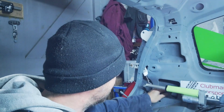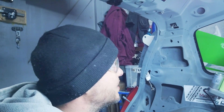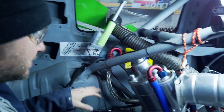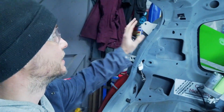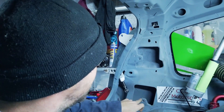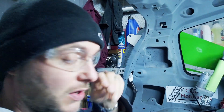They have really thick reinforcements specifically here and here at the bottom, so I don't see why we need this. A lot of people said don't touch it — it will change the integrity because it's structural. Well, structural yes and no. We have a roll cage mounted and tied into the suspension points, so effectively this part is irrelevant. The only thing it does — and that's my main concern — is that my wing is actually attached to this corner. But we're not removing everything, just the inner part.